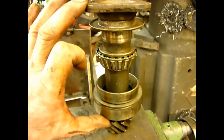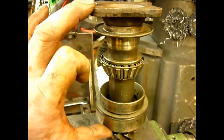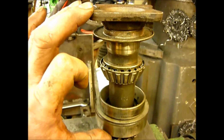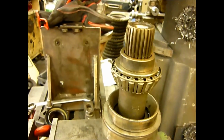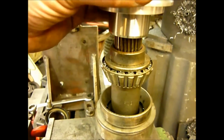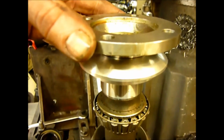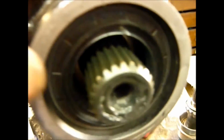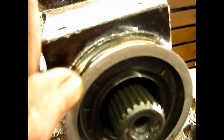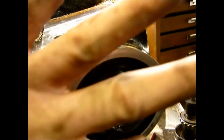There is an amount of movement in here that can make the new flange not actually fit straight away. And what will happen is you'll put the new flange onto this system here, and you'll do the bolt up, and then you'll find that it's gone absolutely rock solid. So there's two things you can do if that happens. The first is to rotate it and actually see if you get scratch marks here, because if that's the case, you'll need to thin this off a bit here.